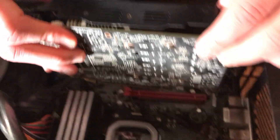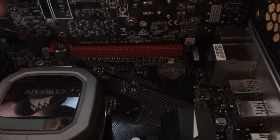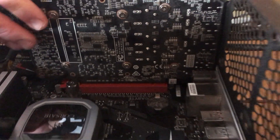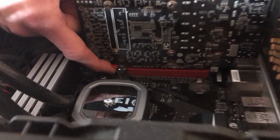So now I'm going to install the graphics card into the slot. You might have a little bit of wiggle room. I've lined it up there, lined that up with each thing, and now push down — and you hear that click. That's the slot locking up.